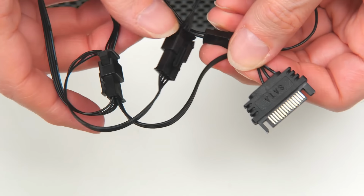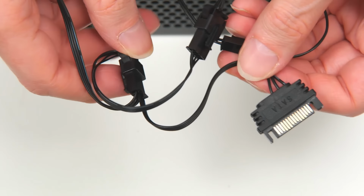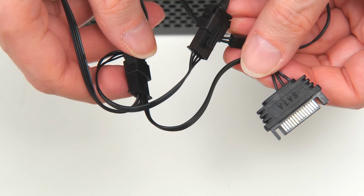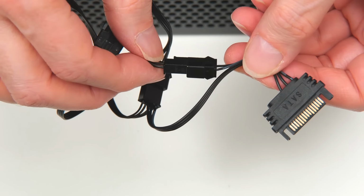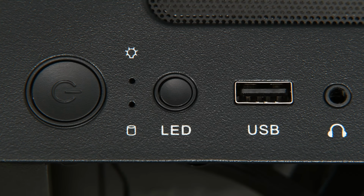And this, of course, means we don't have speed control or speed monitoring on the fans, which is a bit of a shame. I guess it depends how noisy the fans are, whether that's a big problem or not. We will see. And of course, you could replace the three fans of this system with standard fans that do connect to the motherboard. And we also have here this, which is a connection from the top fan to a switch on the case, which can apparently be used to control the LED lighting, including turning it off.